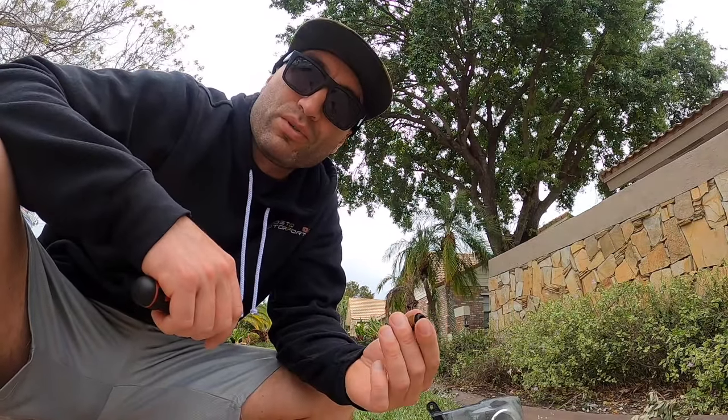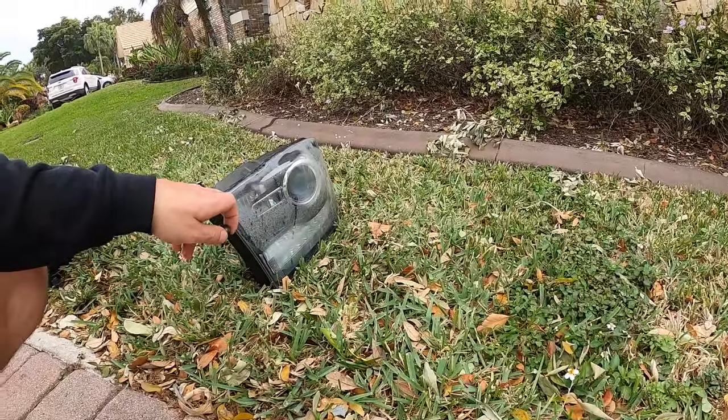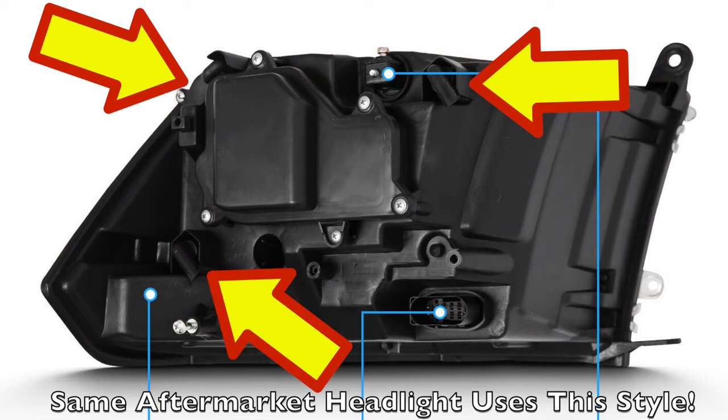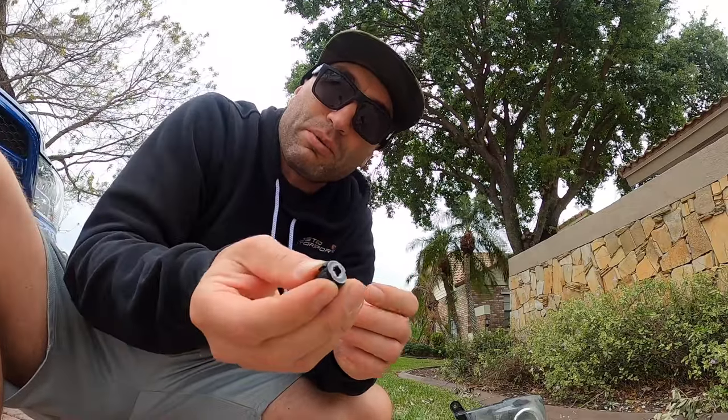That's a wrap for this video. I'm going to wait for that to evaporate, leave the lid off the back of it, and we should be good to go. I truly believe the issue is that these headlights can't breathe — not that you need to seal everything off. Headlights for ages have had vents on the back, and these ones are not venting. I've also seen a guy on the forums who converted back to the old style with a hose loop and a little filter material and never had a problem again. Comment below if that fixes it for you, check out the other Ram videos on this channel, give it a thumbs up if you found it helpful, and hit subscribe.